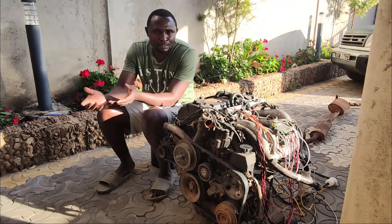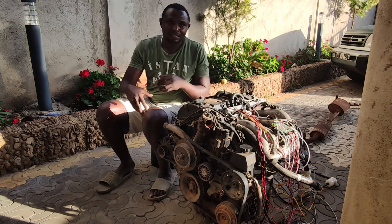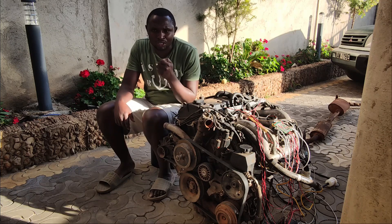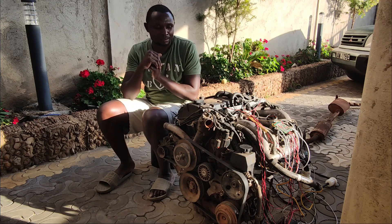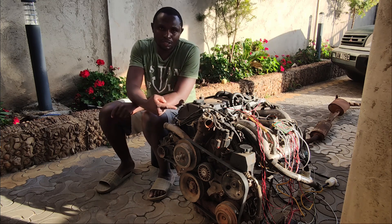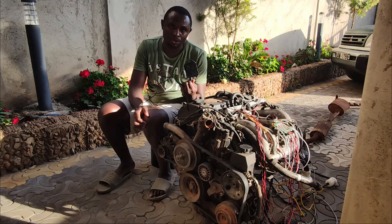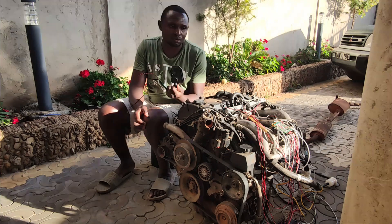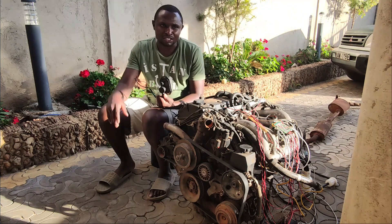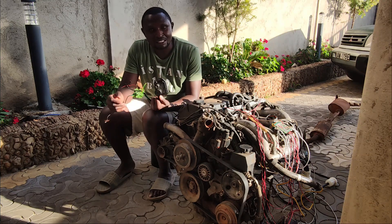That got me confused because I didn't think so much of the blow-by gases. I removed all the spark plugs, cleaned them up, put them back in — nothing. Removed them again, cleaned them, checked and adjusted the gap between the electrode and the housing — nothing. I changed my sparking unit. I'm using a motorbike CDI, and I configured the original ignition control unit. It gave me a very powerful bluish spark, which is recommended. If it's weak it's almost orange and very weak, but this increased the size of the spark — it was pretty strong. But that didn't even save the situation.